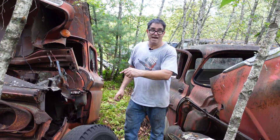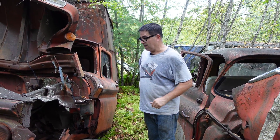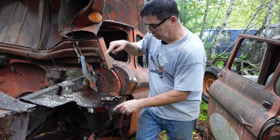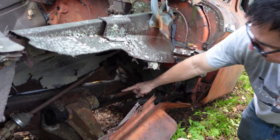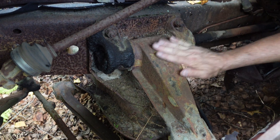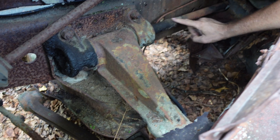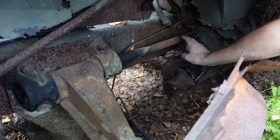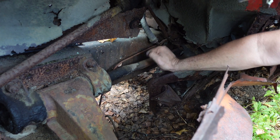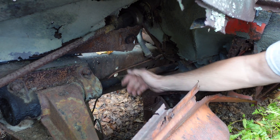A lot of people say no way. Well, today a lot of Chevy trucks since the 80s do have torsion bars up front on the four-wheel drive models. But in 60, 61, and 62 — if you look here — here's the upper control arm, no leaf springs, no beam axle. These are the trunnions, and that's the torsion bar right there. This thing goes all the way back down under the cab. It's anchored at the frame, but up here it's allowed to twist, and the resistance to suspension rebound is what gives this torsion bar its spring.